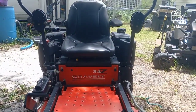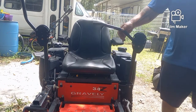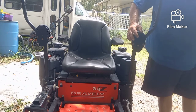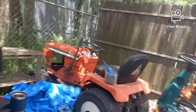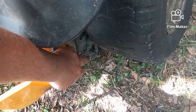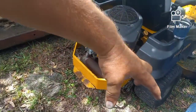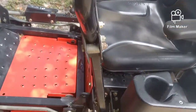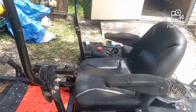But on this machine the arms do not go in and out. The arms themselves are solid — the handle goes up and down. Because of that there's no sliding-arm lock mechanism. If you have trouble starting it, the return springs on the back might be bad. These springs are what make your arms go back to the center position. When you pull the lever it stretches the spring, and when you let go the spring pulls it back to center.